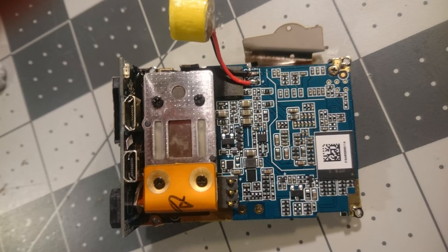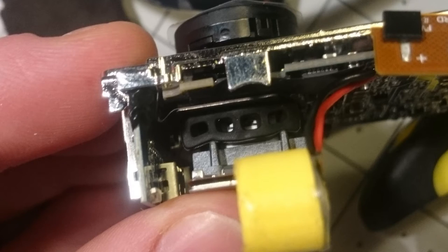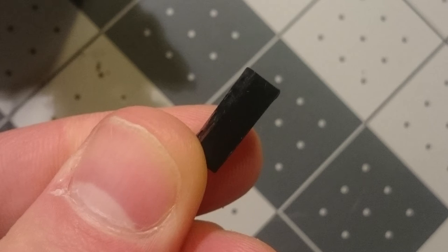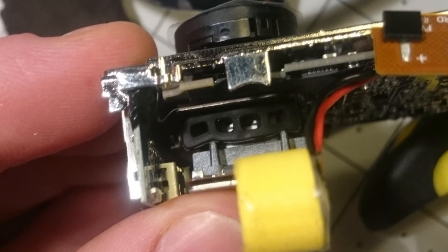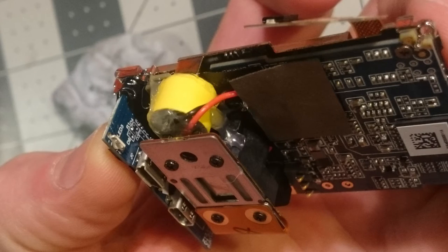We're going to solder the new microphone in to the same place the old one was, but you'll see it's quite a bit larger, which makes it a little trickier to fit back in. There's actually a piece of rubber there that was twice the size needed, so I cut it in half and pushed it back in to make room for the new microphone to slot in. That rubber is stabilising the camera lens and sensor — it's vibration damping — so you definitely want that in there. I then applied some hot glue to keep everything stable and replaced the tape that was there previously.